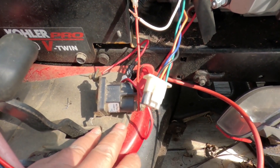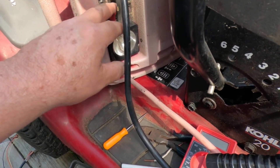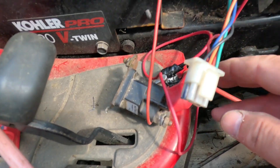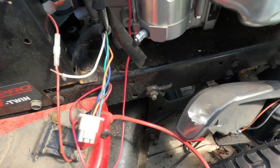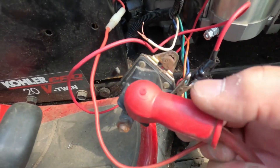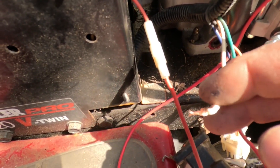I've been playing around with this for a little over a half hour now. When connecting the power source, I'm using this jumper pack because the battery just wasn't holding the charge. I hooked up the ground, then hooked up the starter solenoid and put a ground wire from the starter solenoid to the engine. Then I hooked up a probe light — you're going to need one of these if you're testing it yourself. This is how the power gets back up to the switch through this wire here. I ended up breaking this wire playing around with it too much; it came out. This will be hooked up a little differently — you'll see how when it's done.